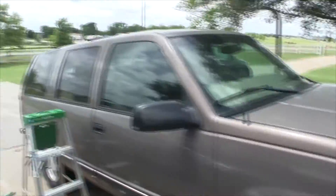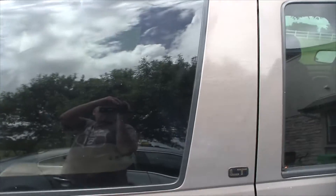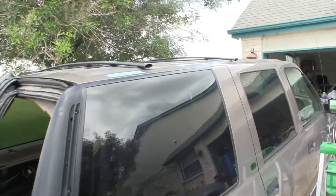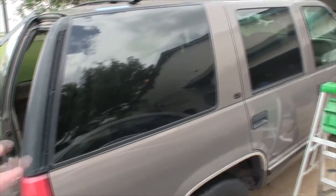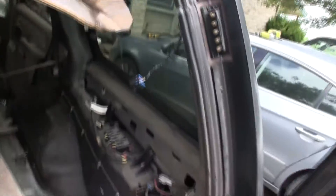Okay, progress on the water leak. When I first looked at this, I saw the owner had taken part of the luggage rack off, but I wanted to eliminate that as the water leak source. That's why I had to pull the carpet and the interior out. The water leak was actually dripping like six or eight inches up from the back of this rear pillar here, so I started a process of elimination.